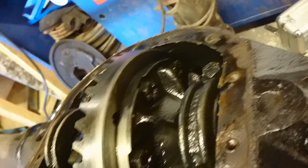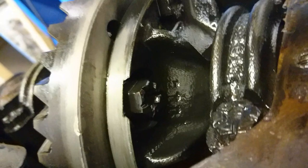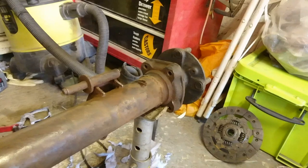It says basically it gives you the factory spec — there is point zero zero six, which is six thou — which is the backlash that I had when I measured it yesterday. So I'm happy with that. I'm going to take the half shafts out, then I'll click back to the centre diff section.